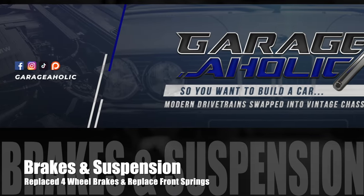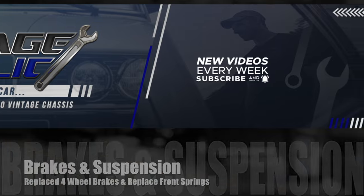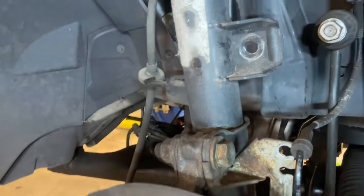The reason we had to replace the front springs and go with H&R lowering springs is because we lost a lot of weight up front. You've got the half shafts, the front differential, the front driveshaft, and we replaced the heavy 5HP transmission and transfer case with the much lighter GS6 420G six-speed manual. We've lost a lot of weight up front, and the new springs will let the front sit where it should — not lower or with an aggressive rake, but the way it should look.